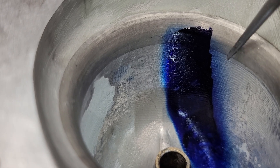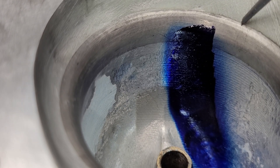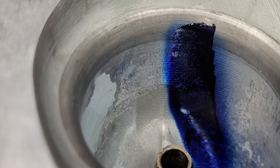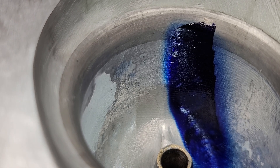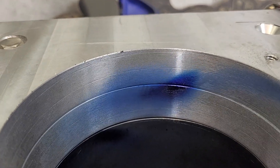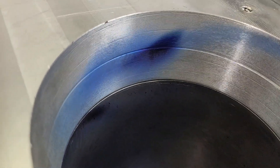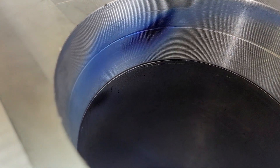As you can see, the valve job is basically a complete radius valve job. Since we are going to be dealing with liquid flow, that's not ideal. A complete radius valve job probably flows more on the flow bench — something to keep in mind — because when I do the valve job, I actually expect to lose some flow, but it will also change some of my airspeeds, which will be interesting to look at. It actually looks quite good on the bore. I would like to see it a little more spread out. My spacers aren't exactly lined up — I assure you they are; it's just the light reflection from our overhead lights.